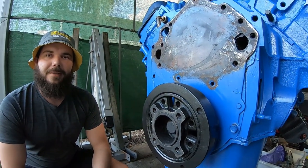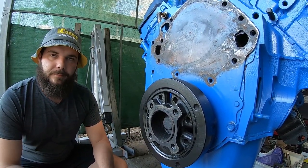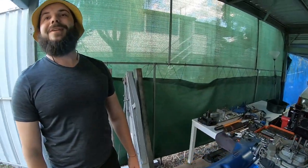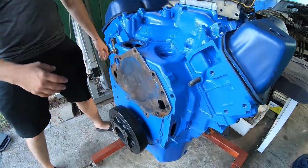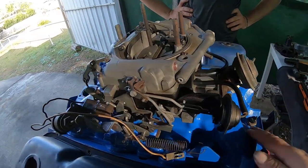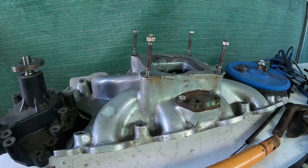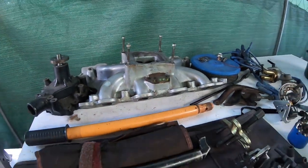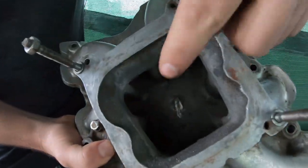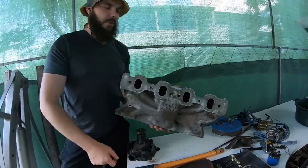We went a bit further — after talking to our mate Scotty at PW, we didn't realise there's actually a shortage of lifters and push rods worldwide because of COVID. So the camshaft we would normally run wasn't available. We came across a Holley single plane intake — a real nice big unit. It's actually a spread port, with a bit of work done, and the port is standard which is very good. You never want to get anything that's been touched around the port area; you always want standard ports.